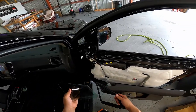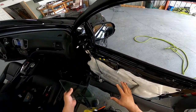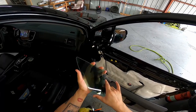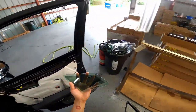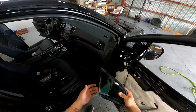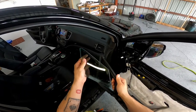And that's how you do it. Then you just reverse it, roll it all back in and you're good to go. If the window does come out of frame, don't freak out — just get it back in line. Maybe roll the window up a little bit and get it back aligned. You should be fine. It shouldn't take you more than five or 10 minutes. At this point I won't cut film from the plotter — I will just tint this glass like this and trim right at the edge all the way. As I'm putting it back together, I have to heat this glass up with a heat gun with the film on there, so that it tacks up a little bit. Because if you don't do that, when you're putting the glass back into this rubber, you can peel it off. Also, last tip: when you're putting this glass back in, put the front bottom in first and then slide the top corner up and over. If you go top corner first, the bottom is very hard to get in.